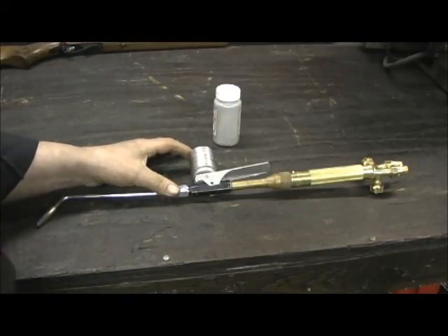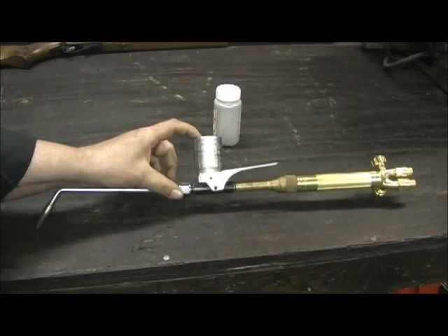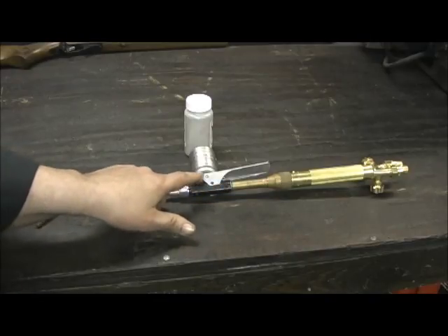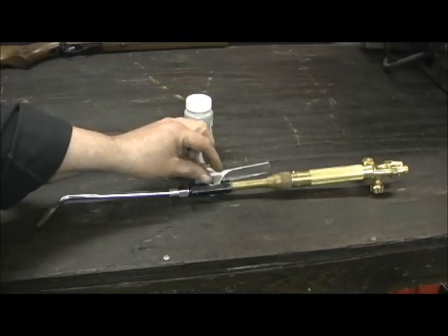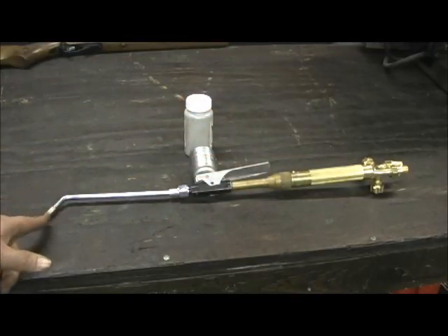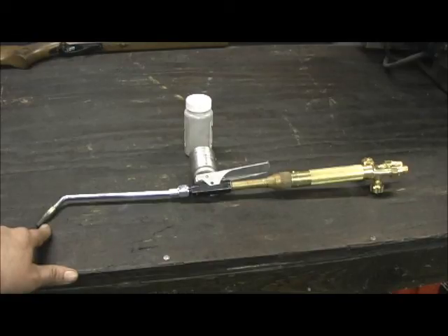This is the Model 10 Maintenance Welding Powder Sprayer. You can see the little hopper with a bottle of 99% nickel. It uses gas fed through a series of venturis — a little rubber venturi with a certain diameter hole in the center to release the powder from the oxygen line and send it down to the torch. For this operation I'm using a number 15 tip, which is a very small one. I don't want a lot of heat — just enough to get it red inside the chambers and do what I need to do.